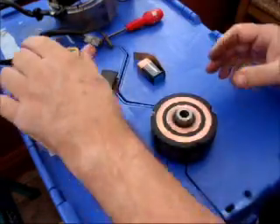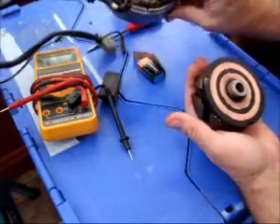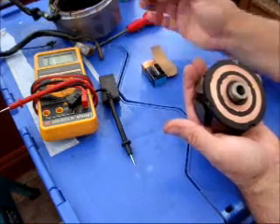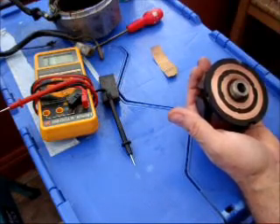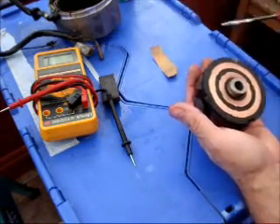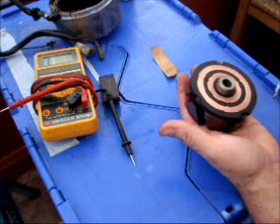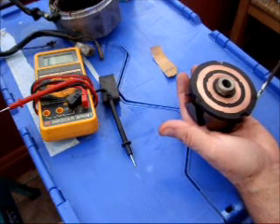I just want to show you one other thing. The way this works is that you put 12 volts through the windings via the brushes from the stator. The voltage creates an energy field within the rotor itself, and when that spins inside the stator, that's what generates the AC voltage. To test this quite easily, there is something called a slap test. Basically, you put 12 volts through the rotor when it's on the bike. You put some feeler gauges, or something very thin metal, very close to the rotor. When you turn the switch on, 12 volts passes through the rotor and it should generate a field which acts as a magnet and pull your feeler gauge in to slap the side of the crankcase. That's the slap test.